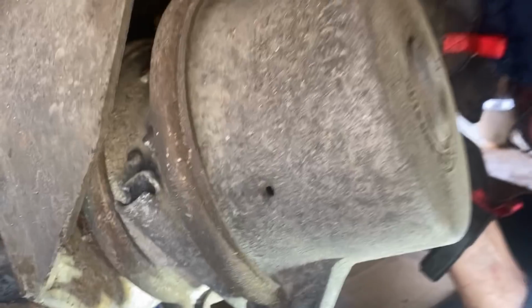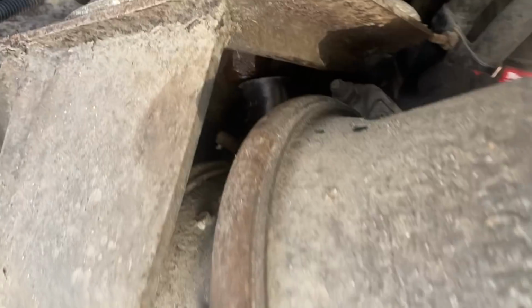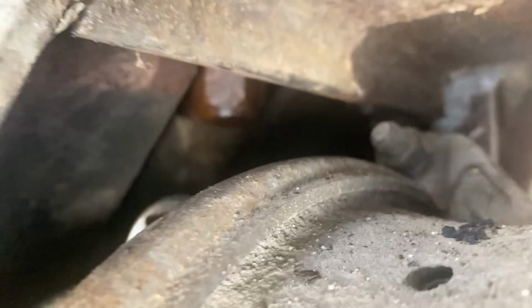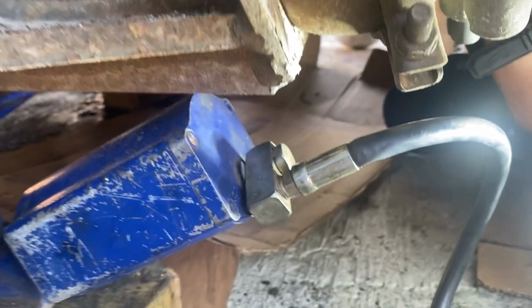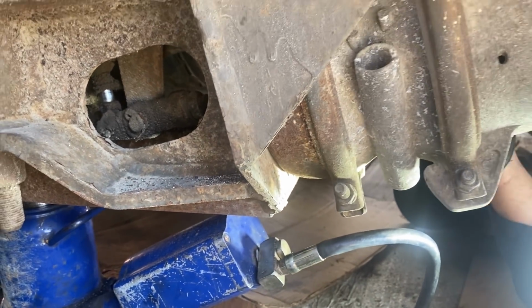You know, new spring brakes, the spring cage, you can't even take apart, but this was back when they let mechanics service them. So we're trying to get to that nut. We might have to remove this brake chamber, which is still going to be a challenge in its own. There's some nuts in there that hold it on, which we can get to, but our jack is in the wrong spot. Okay, thank you.